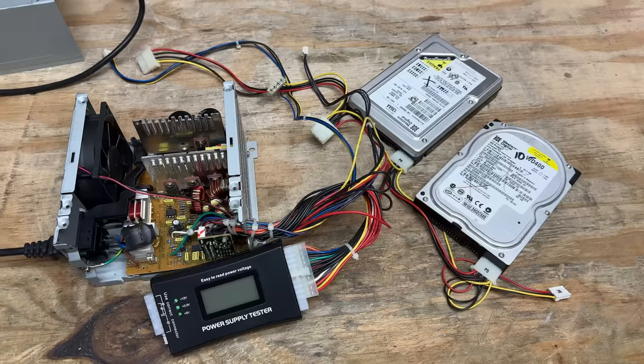Let's go ahead and start case cleanup. I'm going to try to preserve as much of this label as possible, though I'm not optimistic. I'd really love to try to reprint it but I can't find a high enough resolution image. I'm going straight to the magic eraser - you do have to be careful with these because they can remove the texture. Just try not to apply too much pressure and make sure you're using a good solvent. Windex and IPA are a good choice. Those were some tough scuffs but at least they cleaned off. I'm just going to leave the remnants of that label in place. And finally, we found a survivor. This one doesn't even have any plastic damage, and that functional original hard drive is just a cherry on top. These are definitely the type of systems that nobody thought would ever be interesting again.